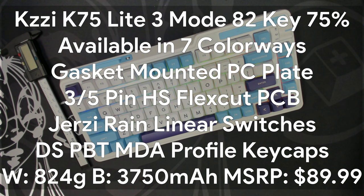The front of this keyboard sits at 17.5 millimeters off the typing surface, while the back sits at 29 millimeters, providing for a default typing angle of 7 degrees. Flipping out the first set of fold-out feet will take the back up to 33 millimeters, changing the angle of typing to 9 degrees. Flipping out the last set of fold-out feet will take the back up to 37 millimeters and provide a typing angle of 11 degrees.